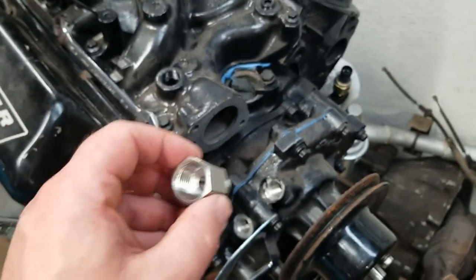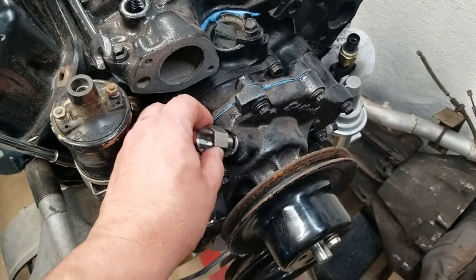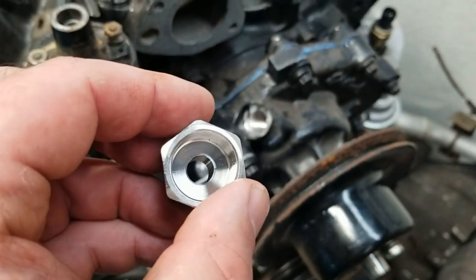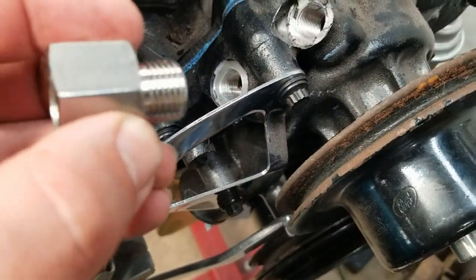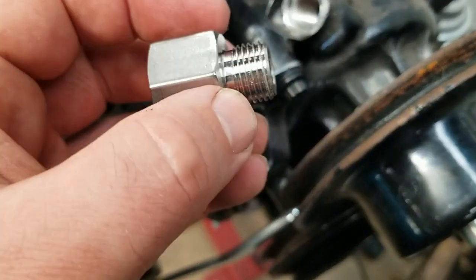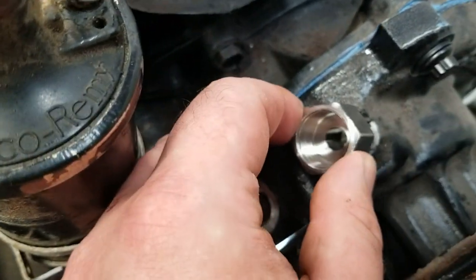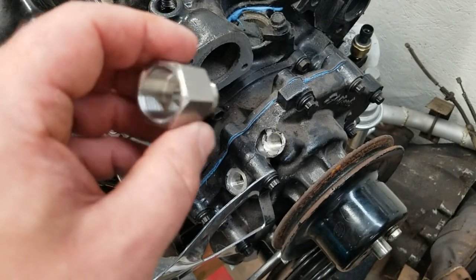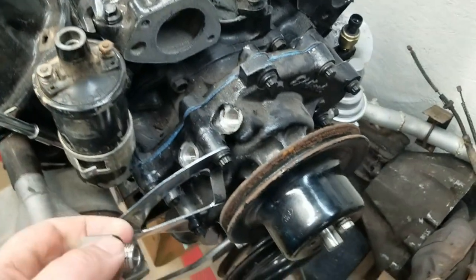This thing cost me sixteen dollars for one, which I'm not too bummed about because it's the right thread - it's a 16 millimeter thread. But you see how they have this counterbore in here - that's not gonna make it. It also hits on this counterbore a little bit. Maybe once I get the crush washer in there it'll fit, otherwise I can chuck it in the lathe and take a little bit off, but taking off anything of this one you wouldn't have a fitting left. I'll have to see if I can get one going from 16 millimeter to three-eighths NPT instead of half inch.